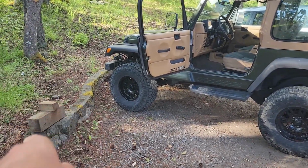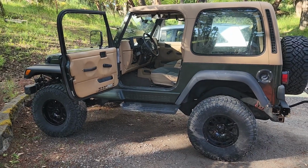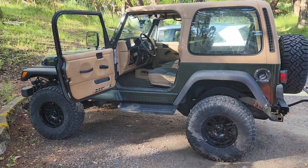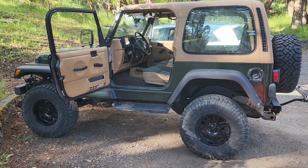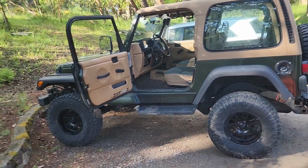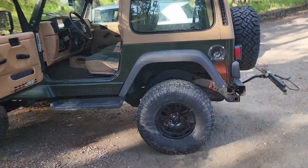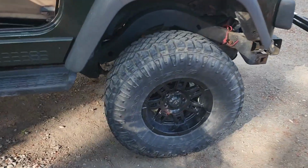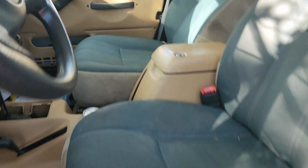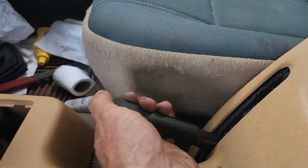But if you're pointing downhill, nose downhill, it works incredible. It'll hold you if you were pulling a 10-ton trailer. But yeah, pointing uphill, going backwards, no, you're going to stay loose, especially once you get bigger tires too. So I adjusted it the best I could. And you could see it clicks. A couple pulls and it's starting to lock up.